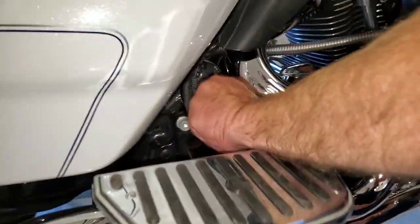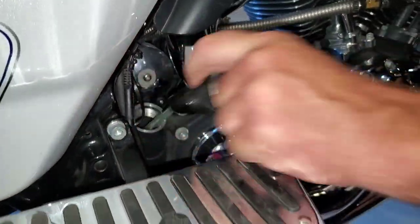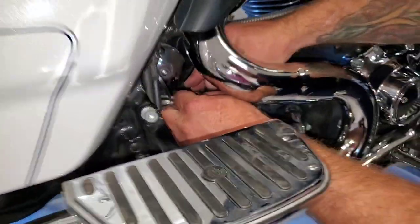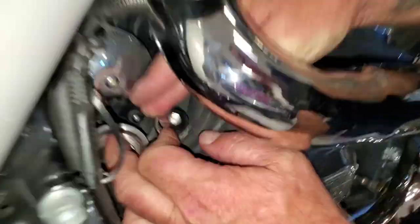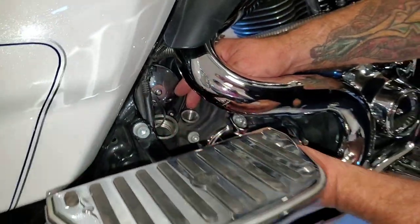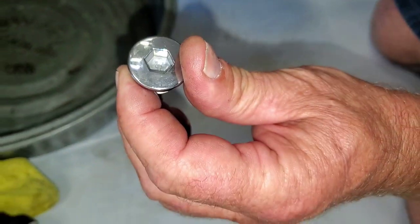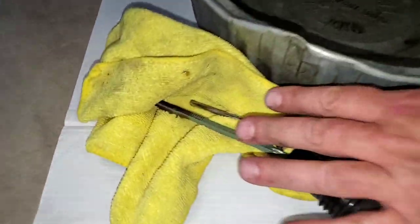To prevent vacuum, this guy here is the motor oil fill spout, so we want to pull that so that we don't get vacuum. This one here I've already loosened because I knew we were going to be doing this. This little drain plug here is for the transmission. Now this looks like an 8 or 10 mil, but it's actually standard — this is a three-eighths socket head. So those are both the dipsticks.